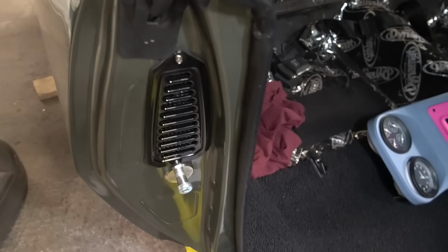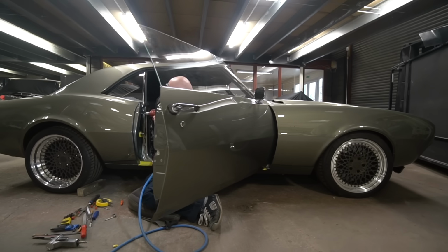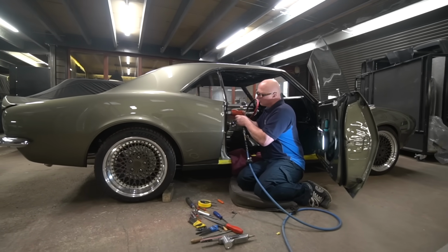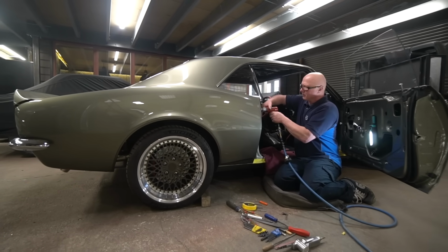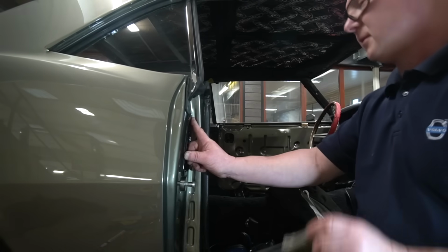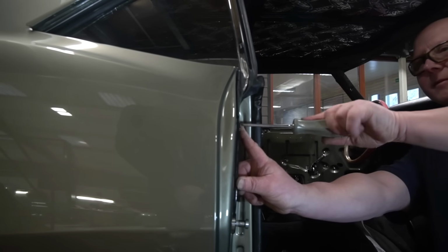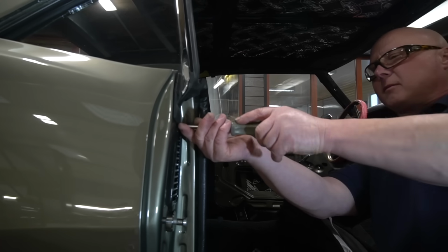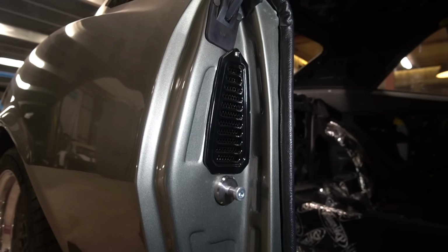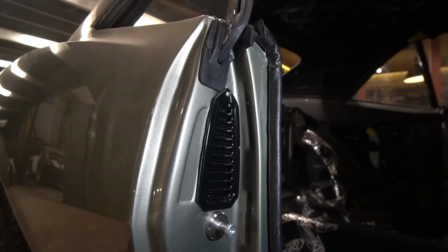And the B-pillar vents, which I think Anthony had generally a complete nightmare with, not because the B-pillar vents are badly made or wrong, I think because the quarter panels, because they're repro quarter panels, I'm guessing the vent detail and the structure behind was slightly different because he had multiple problems. The shape wasn't quite right of the actual hole. Then there's a structural bit behind there, which was overlapping the area that I had to go into, which was also in the way. So there was some careful die grinding and an illustration. I mean, these vents were something I decided to put in more recently rather than the original plastic ones, but they're an illustration of why one should always take one's dry build to the nth degree with all of the final parts rather than original parts, which might then get changed later.